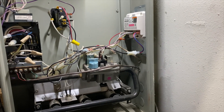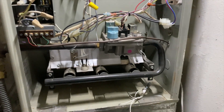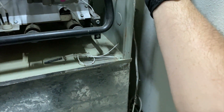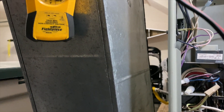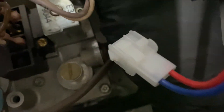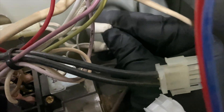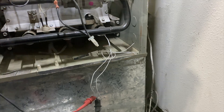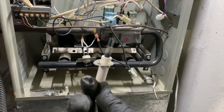This looks like a multiple offender. The igniter is not coming on. Looks like somebody tried to change it — I ohmed it out and it's open, so this one's definitely dead. Whatever they did must have screwed this up. We're going to set our meter to ohms — I'm getting an OL, an open line. So I'm ohming out the igniter and I'm getting an open line, so this igniter is no good.